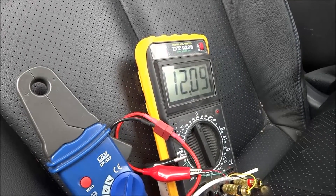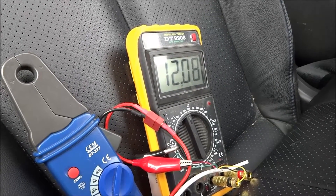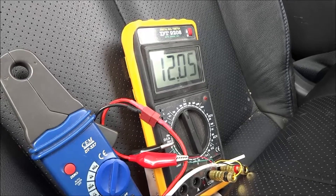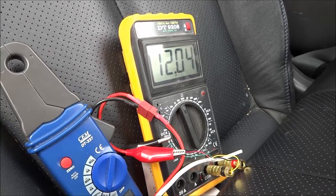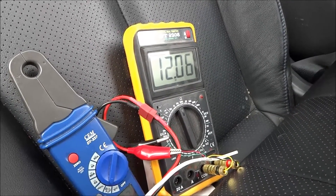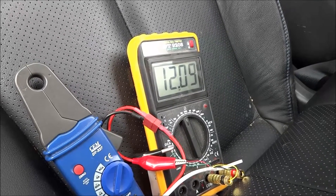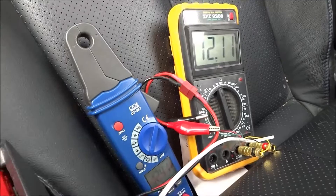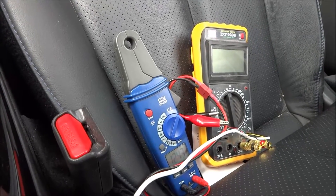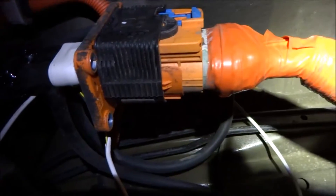The splice is not warming up at all, and I'm actually kind of surprised because 250 amps on full acceleration is going through there. I thought it would heat up at least a bit, just normally, because the wires are about 1-0 gauge — not that thick considering the amount of current. But I guess it's not for long periods of time; you don't accelerate for more than about 10 seconds at most. So I guess that's a positive result — I'm very pleased with this.